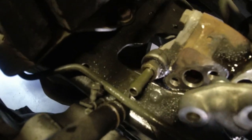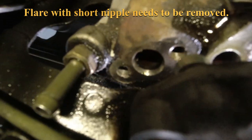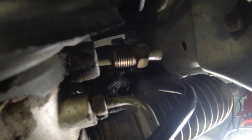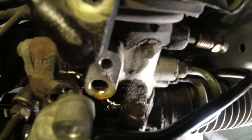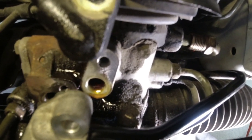Okay. I got the rubber hose off there. That one pulled out of that hole. You can see the little rubber O-ring. And I got this one pulled out of that hole. So I've got that flare nut backed all the way out. So everything is disconnected here at the steering box. So I think we're ready to pull the steering rack,